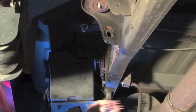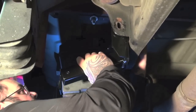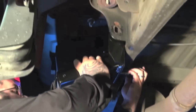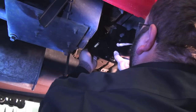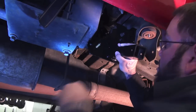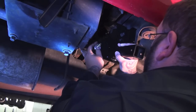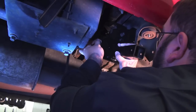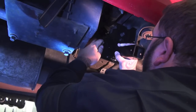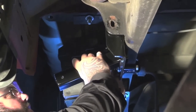Next, you will take the frame unit and place it up over that bolt. You will grab your second hook bolt — it too slides directly over the frame, and there are already pre-existing holes. You will put two flat washers onto the grade 8 bolt, one half-inch lock washer, and then thread on a half-inch grade 8 nut. Leave these hand tight to ensure the frame unit does not come off the frame and cause any injury.